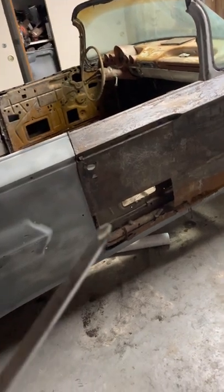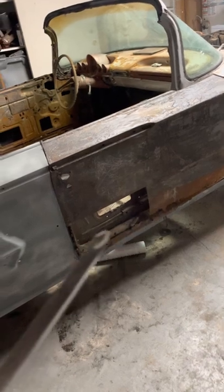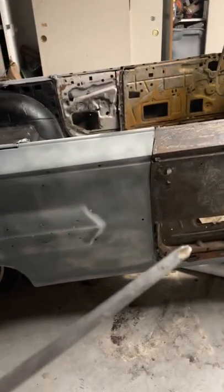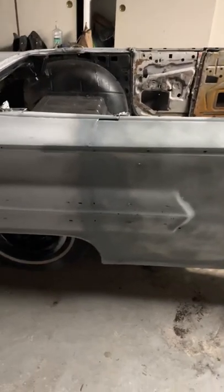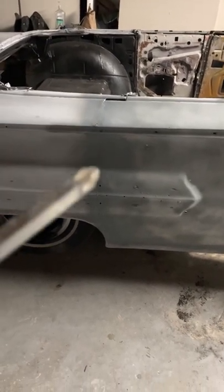Wasn't easy but it's possible. I'm gonna use the old door to repair and patch it, so it should be pretty easy. I cut the door a couple inches off, shaped it to the shape of the two-door, and that was it — welded it together, tack welded, and sealed it up. I still got to do a little bit more grinding.